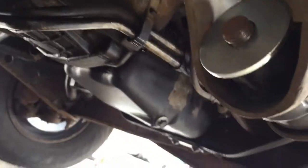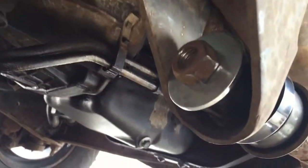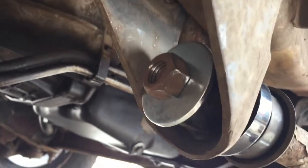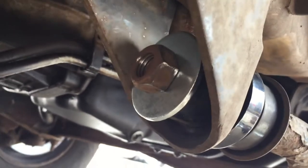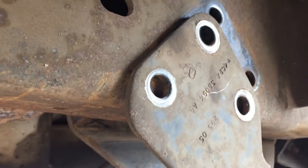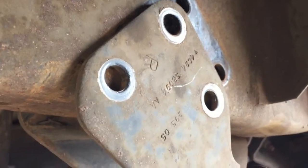It was hiding underneath a broken bushing — so here's our nut. On the back, on the other side what I did is put that on and torque it down. It was 180 foot-pounds to torque this nut right here, and then these three bolts were 68 foot-pounds. So we're going to do that and then we'll be finished.